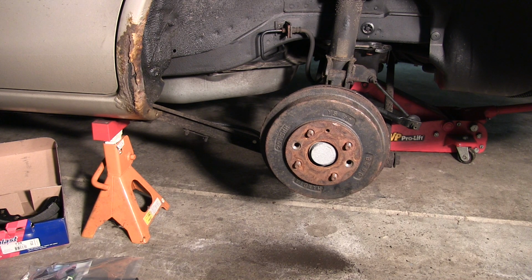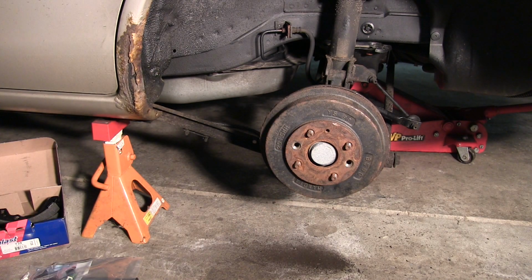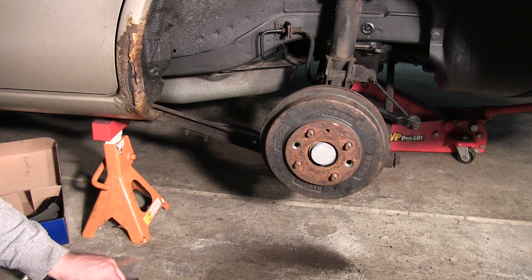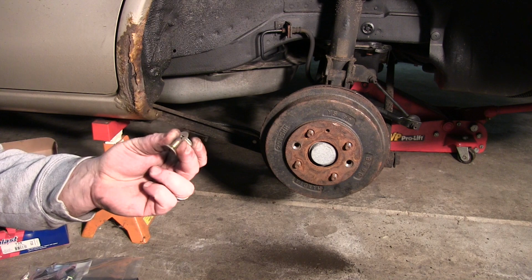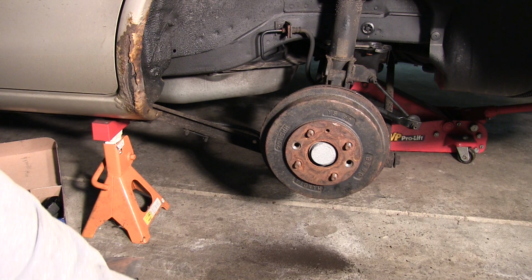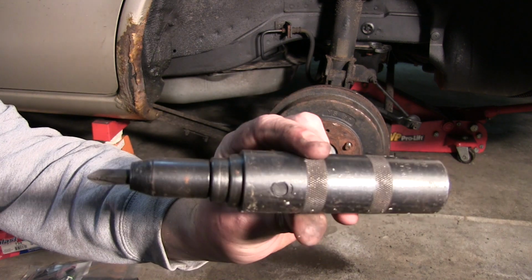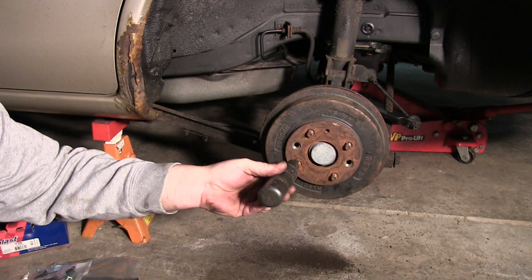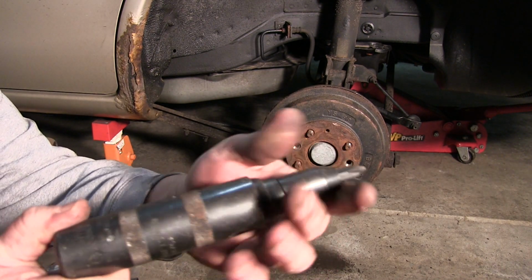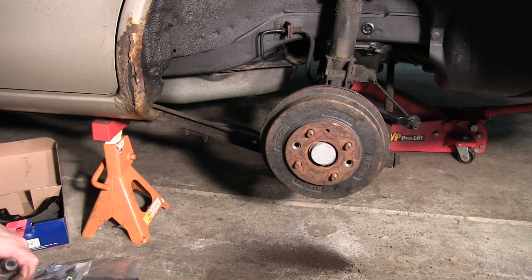They're all pretty similar. This particular set has two screws. I've already taken them out, right here and right here. That's all that's holding it in place. Of course, when the wheel's on, that's holding it in place too. So if you lose these or they're stripped out, that's not a huge deal. I recommend getting them out if you're going to try to reuse them. You get an impact screwdriver like this. Essentially you hold it on there, you hit it with a hammer, and it turns just a little bit. It's definitely a necessity. That way you don't strip them out and they come out pretty easy.